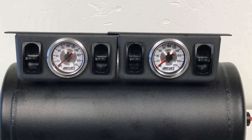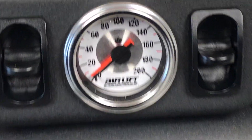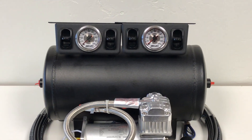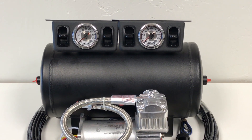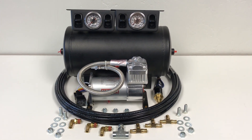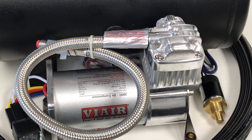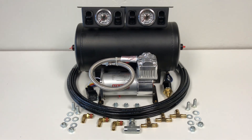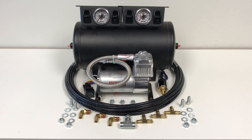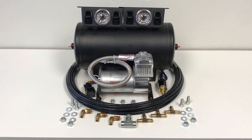It uses manual valves and each gauge has dual needles, so each wheel gets its own little valve. We run quarter-inch line, and the kit comes with — I think it's 100 feet. It also comes with a Viair 280 pump, perfect for the application. The amp draw is about 13 amps; if you get into the bigger ones, they can steal from your distributor and charging system.